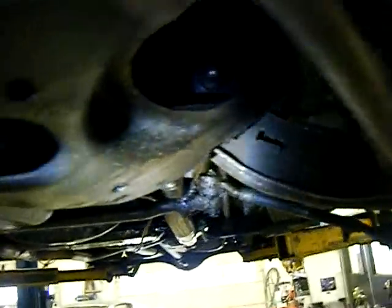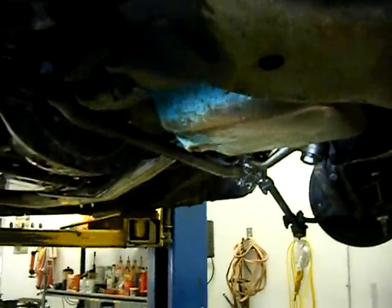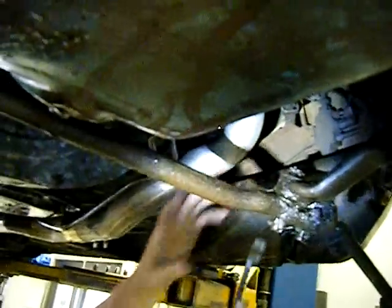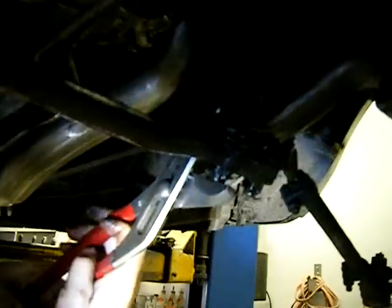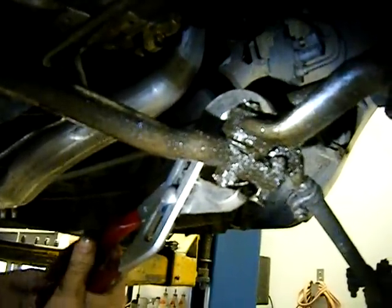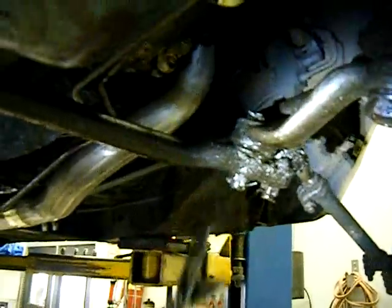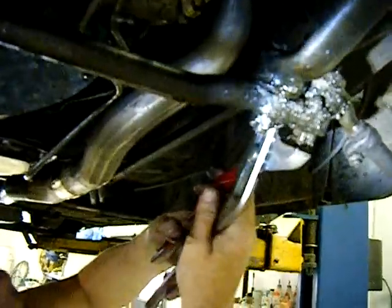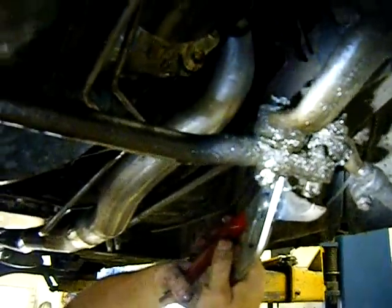New shocks. What I did is I tested the pitman arm — it's soaked in oil, which is not a big deal for a pitman arm itself, but I gave it a squeeze test to see if it had any movement, and it does. The pitman arm, when it's got movement like that, it's going to make it rock back and forth, so the pitman arm should be replaced. The customer did say the steering felt quite loose. This one has a minimal amount of movement, so it's okay.